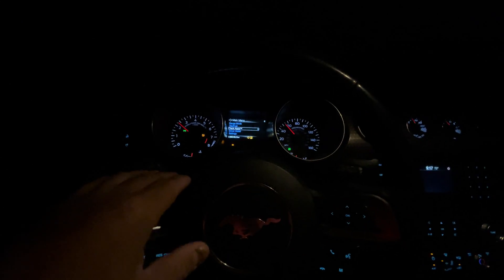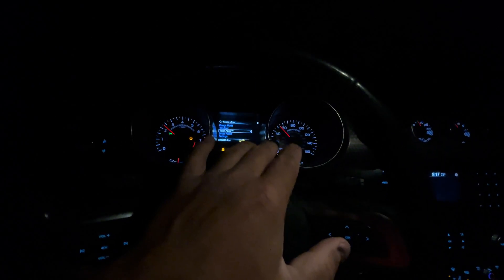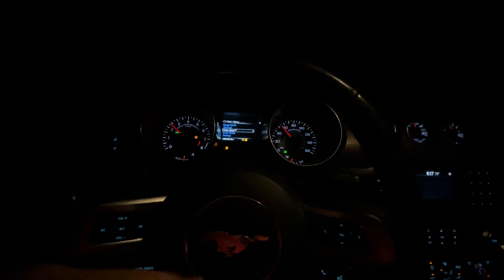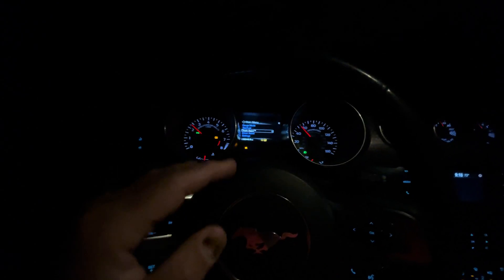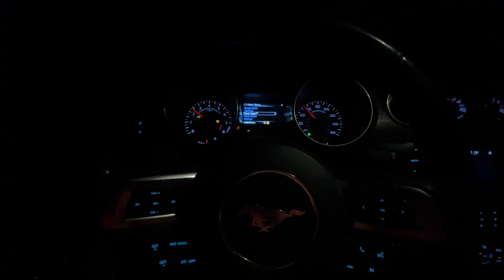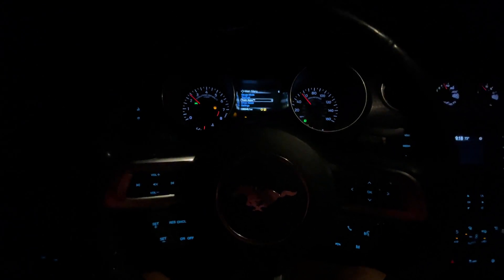In my opinion, it would not be useful in that sense. But if you're supercharged or NA and you just want to do rolls and set a limiter so that you are exactly at 60 mile an hour - 5,000 RPMs at whatever gear equals whatever RPM equals whatever mile an hour - it'll be something that's repeatable and you won't go past or under that predetermined RPM. So I thought I'd bring you a quick little video, one take, to give you a very quick run-through of the possibilities of this rolling rev limiter that will allow you to maintain an RPM at a predetermined spot on the fly. Thanks for listening guys, talk to you later.